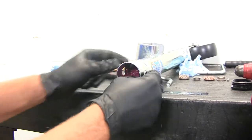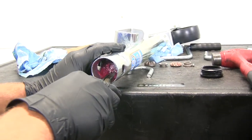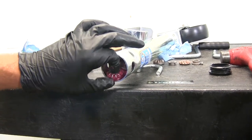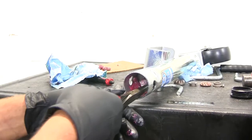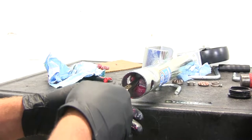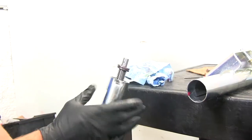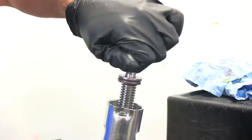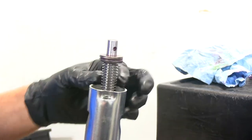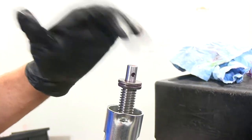You've got those spacers — those are just going to push in. The one goes towards the handle side. Now if we look down at the bottom, it's going to be our main drive gear. This one's designed to hold the pin in place so it can't pass out. To remove this pin, you'll typically have to turn it towards the small hole in the side of the jack so it'll come out that way. Once we take the outer tube off the inner tube, you can see we've just got two washers with a little nylon washer between them to help reduce friction. That allows our screw to spin, coming up and down, forcing the leg of the jack down or retracting it back up. These screws are super dependable and very reliable — issues typically come higher in the system, up where our gears are.